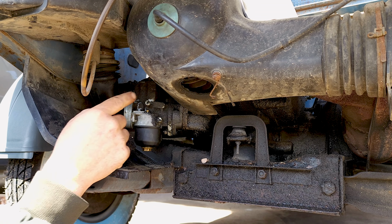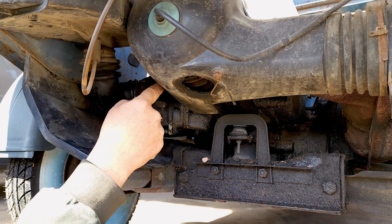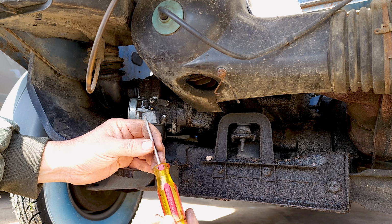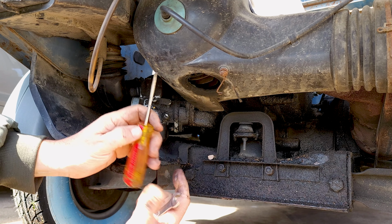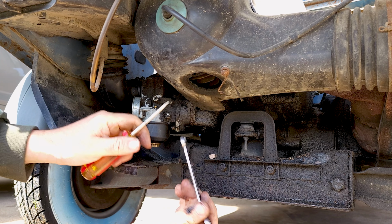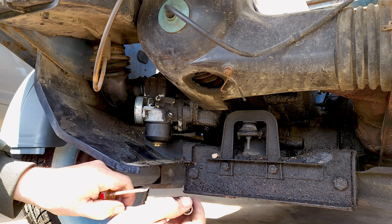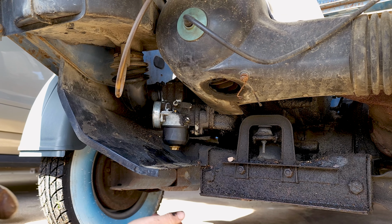Now, what you're going to find out at the top, there's 2 cables attached. One is for the throttle and one is for the choke. And to remove those, you'll need just a flat screwdriver to take the top of the throttle slide off, and you need a 10 millimeter to take the choke off. Then you can remove the whole carburetor to take it apart and clean it, which we'll show you in the next video. All right, so follow us to the next video.